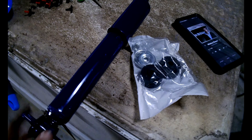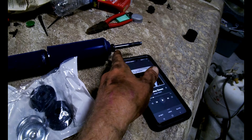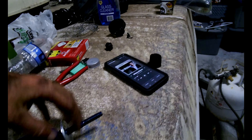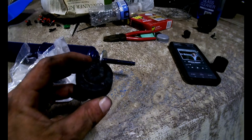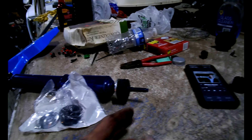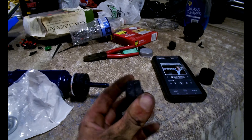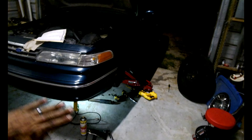Here's our new shock and new shock hardware. We got to stack a washer on the bottom there, put one of these on top of it like so. You'll notice there are different size doomajickies on the bottom. In our car, this wider one fits up nice and snug into where the shock mounts into on the frame rail. So this part goes like that — it goes up into that part in the frame rail and locks in there. Then the next one goes on the opposite way with the fat bit coming down, and that sandwiches in that metal slot on the frame rail.